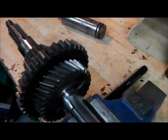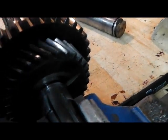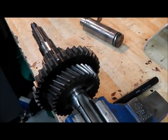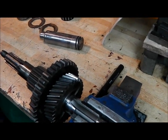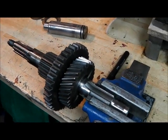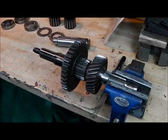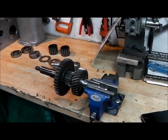Another thing that is worth mentioning is the condition of the gear teeth - these are actually quite good but there's pitting in some of them, and pitting usually ends up resulting in failure somewhere down the line. Also if you're pairing new parts with old, with gears particularly, sometimes they will never quieten down. That's why I'm considering replacing that intermediate gear shaft so it is all new - it all beds in together and hopefully results in a really nice quiet box.